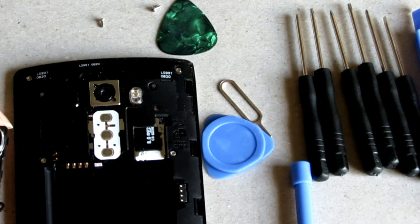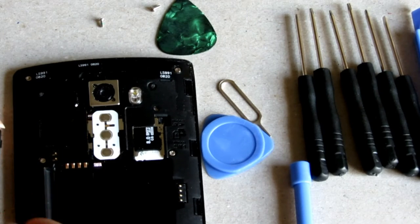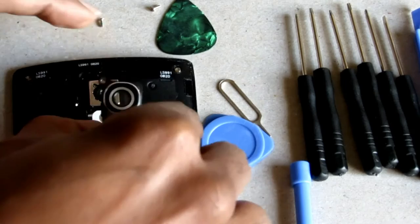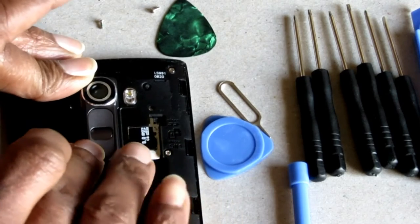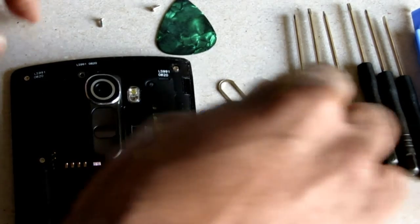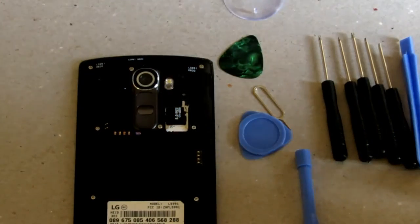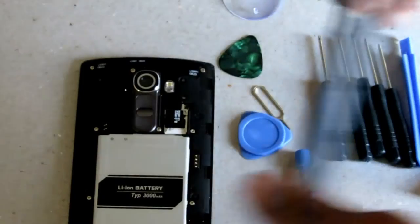I set the phone down to make it a little easier. You have these three little tabs — that's volume up, volume down, and in the middle, that's your power button. You put your little power button back on the outside, line up your lens, and then simply just pop it into place. Put your two screws back in, screw them back in, put your battery back in, and turn your phone on after you put your cap back on.